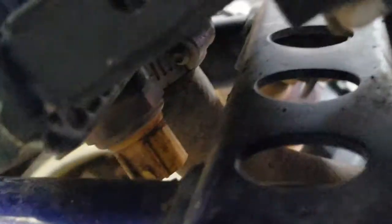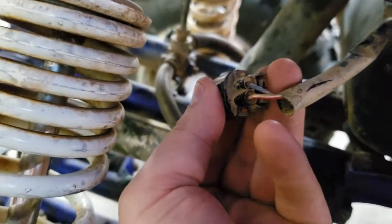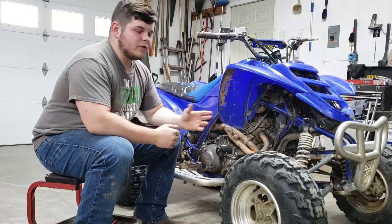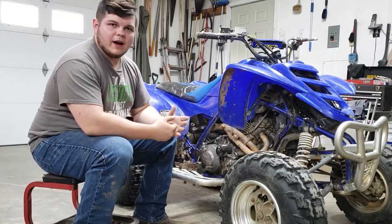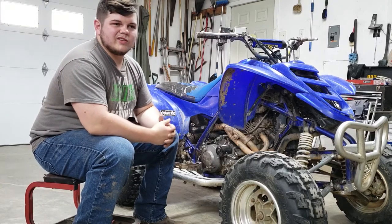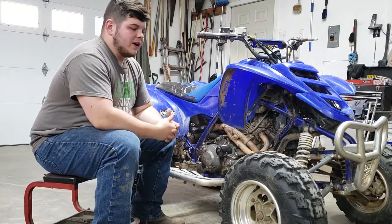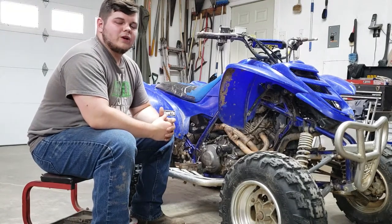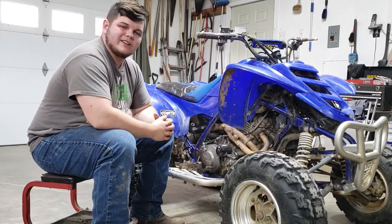The first thing you can do to check the fan circuit is take off the sensor connector at the bottom of the radiator and, with the key turned on, short that connector. If you short it, your fan should turn on if everything is okay. If not, you have a fault somewhere that you should diagnose or send to a dealer to fix. That wraps up this video — if you have any questions, comments, or concerns, please leave them below, and if you'd like more videos like this, please subscribe.